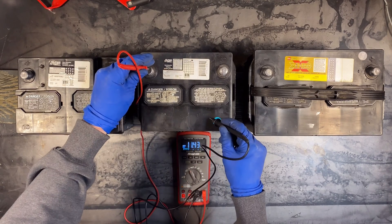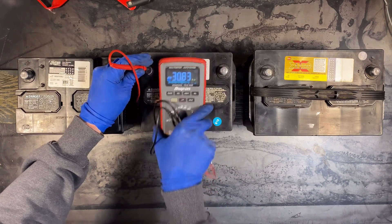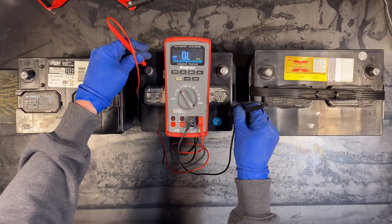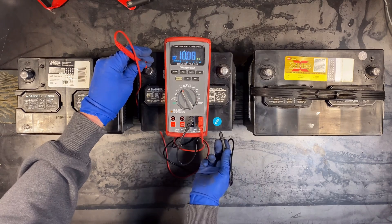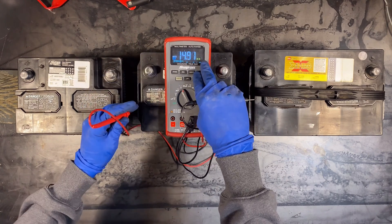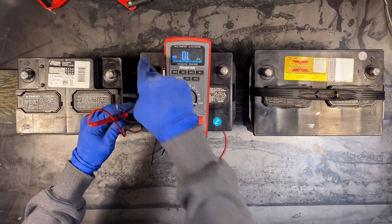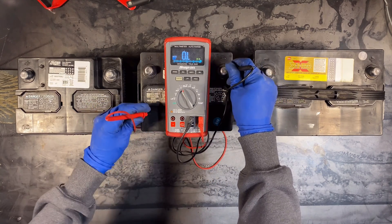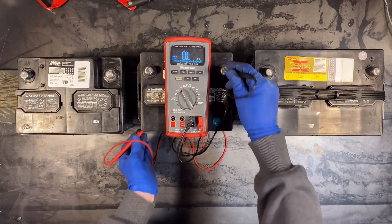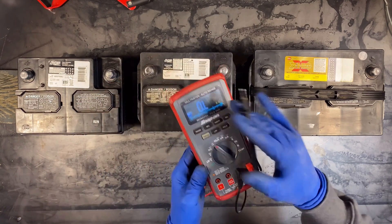Let's check this older battery. We're getting a reading — that's pretty surprising, not much. My scale goes up to 40 megaohms. Let's try that again, from the positive battery post to the top of the case — it just goes over 40 megaohms. Down here, yeah, and we go past 40. Once you get into higher resistance readings it takes a while for it to break through. So there's some continuity — very high resistance between the positive and the case.